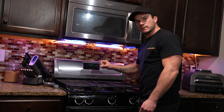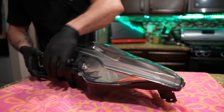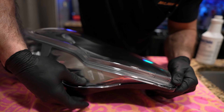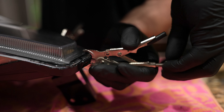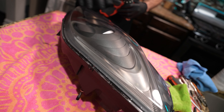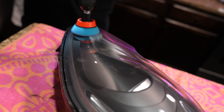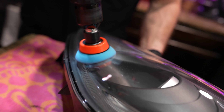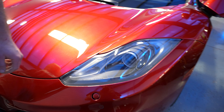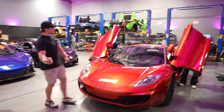Time to go in — 11 minutes. Pull it out of the oven. Now all we've got to do is squeeze it together, making sure to close these tabs as you work your way around. Now grab some clamps. Got the headlight all back together — we're going to do one more final polish over the top and this one will be good to go. All right guys, headlights are done. Let's take a look — nice clear shine, no more mildew. I hope you guys enjoyed the video. Don't forget to like and subscribe!